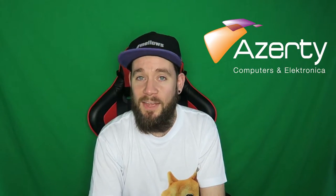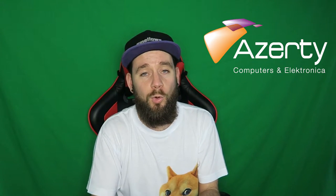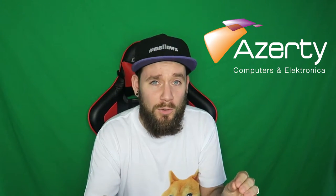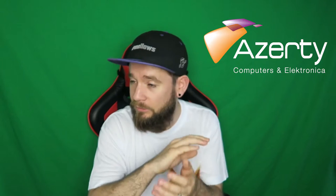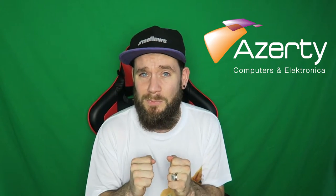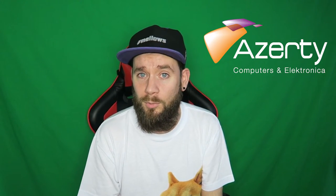As you saw, guys, that is how you install this processor into its socket. It's not that difficult. Again, like the motherboard, be gentle. One really big tip: never, and I repeat, never touch the pins that are in the socket. Never drop the processor on it. Never drop anything on it. Don't leave the pins exposed for too long, as dust and mud and crud and, you know, stuff that doesn't need to be in there goes in there. Be really gentle with the pins. Trust me, boys, don't mess up the pins, because you can throw away the motherboard probably.